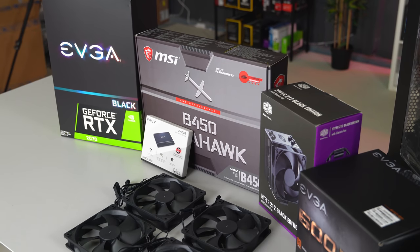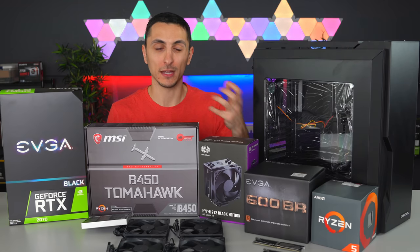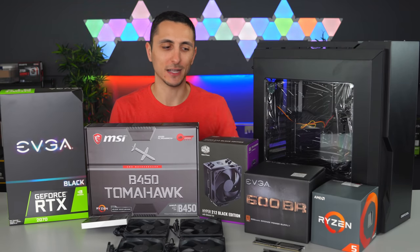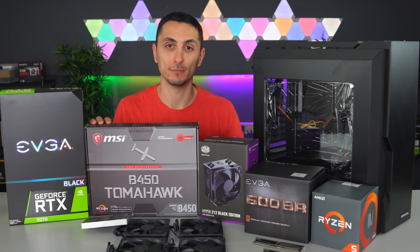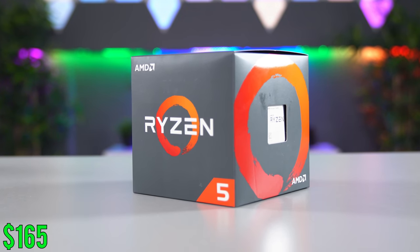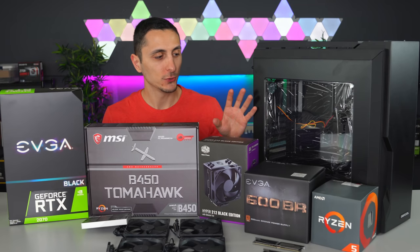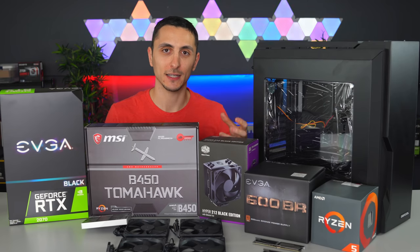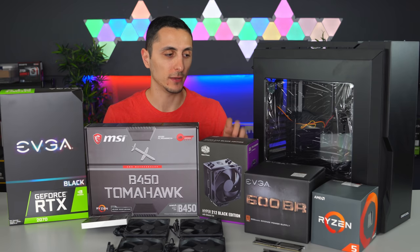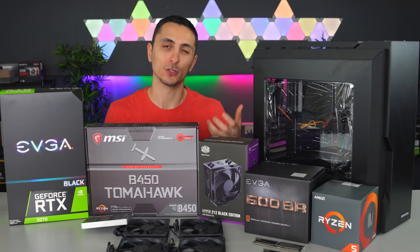This is actually for a subscriber. He reached out and asked me to build the best possible gaming and streaming PC for around $1,000, and these are the parts that I recommended him. All right, so the Ryzen 5 2600 fits the budget perfectly. It's a 6-core, 12-thread processor that offers the same performance as the 2600X after overclocked, but it's $35 cheaper. The extra 2 cores will help out when it comes to multitasking and encoding, so it's gonna be great for streaming. It's also gonna help out on video editing or any other applications that require multiple cores.